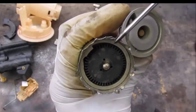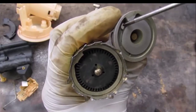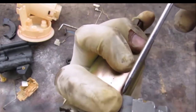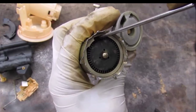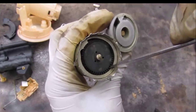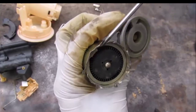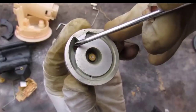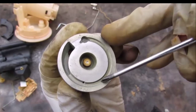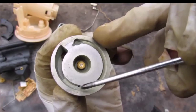I'm going to open up these tabs here. The way this fuel pump works is actually pretty interesting. The intake side here is where fuel comes in, and it goes into the fuel pump. We've got this little gear with paddles on it that moves round and round with the rotation of the motor, and then it exits over here into the DC motor itself and comes out the other side. On the cap you'll see it gets shallower and shallower as the spiral goes in, compressing the fluid into the motor.